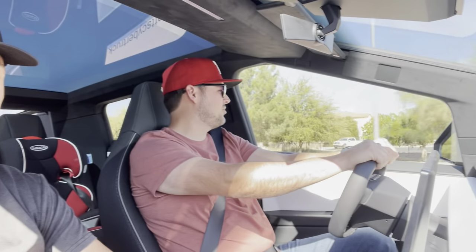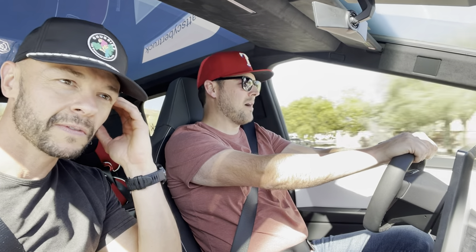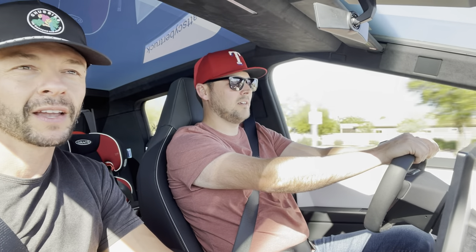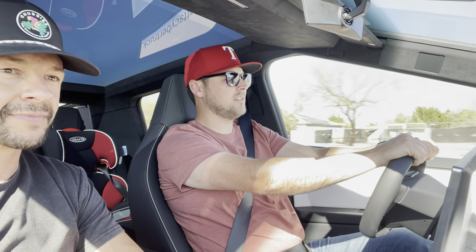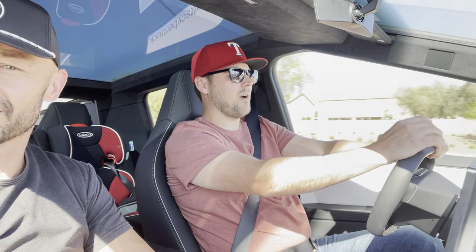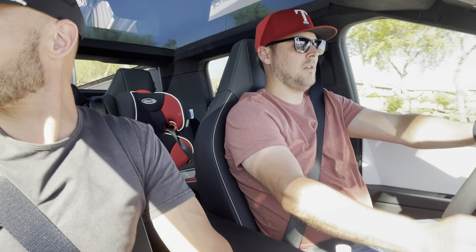It's kind of silly to judge a vehicle's towing by its acceleration. I mean, it needs to be able to accelerate — we have the mountains here, merging onto the highway, getting around something. But the brakes could use some work. When you're towing, you want to give extra distance, you want your brakes to work really well. Let me turn that trailer brake gain up. I turned the trailer gain up to 5.5 — it was at 4. There's also a trailer brake boost.